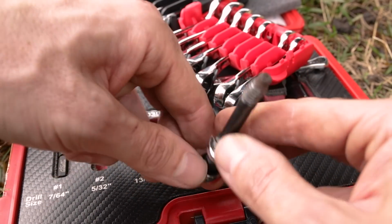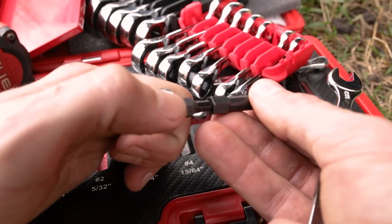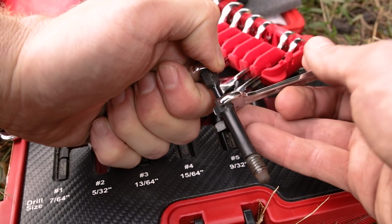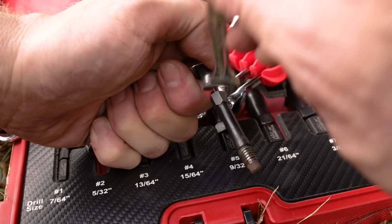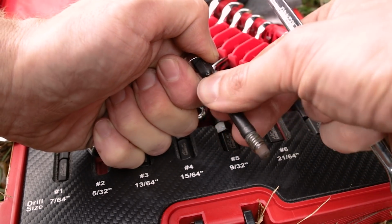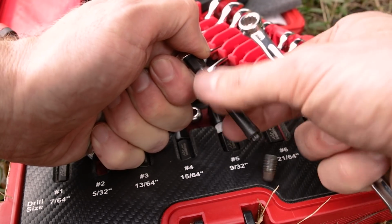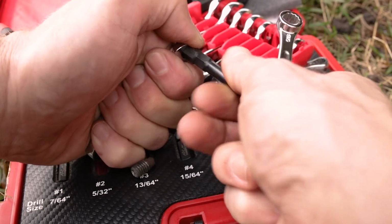All right, so now that we're set here, I've got this locked into place. Now I'll just take the wrench, turn this collar, and the collar will force our broken nub off of the end of the extractor, and boom, it falls right off. Easy peasy.